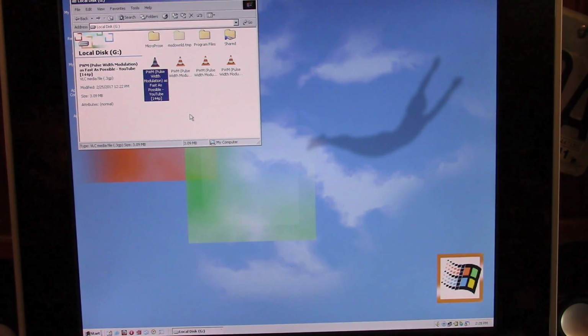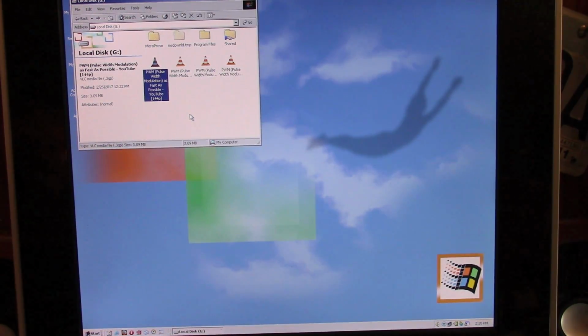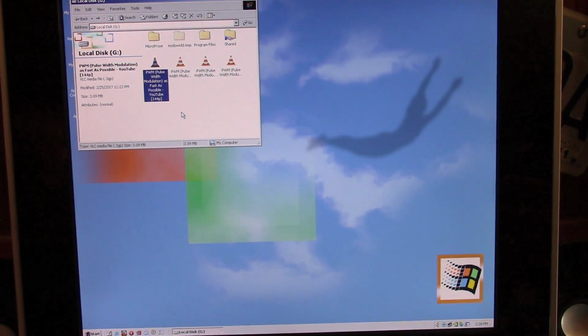The video card probably isn't being stressed at all. But the point of getting a later graphics card than, say, a Voodoo 3 was the hope of potentially playing video files. So we're going to run some tests with VLC. I've tweaked the settings to ensure that it's putting everything into performance rather than quality, which is a sad thing to say. And so now, full hardware acceleration, full buffering. So we'll see what happens. These files have been put on the G drive, which is the 750 gigabyte IDE hard drive. So it should move the data faster than if it was on the main drive.